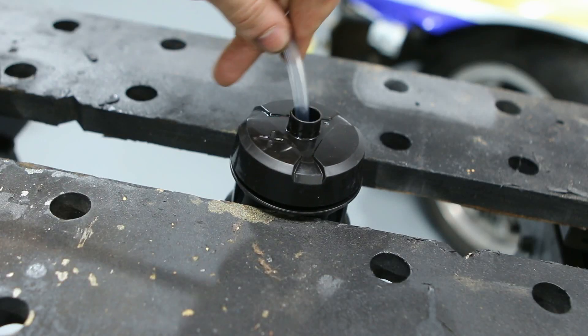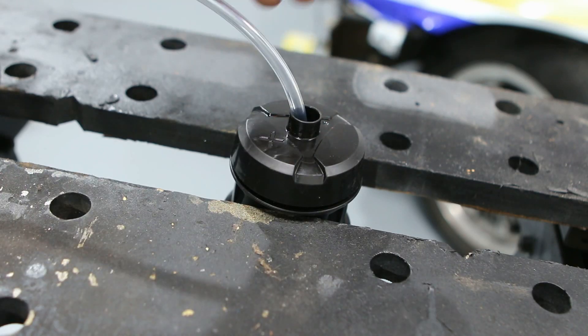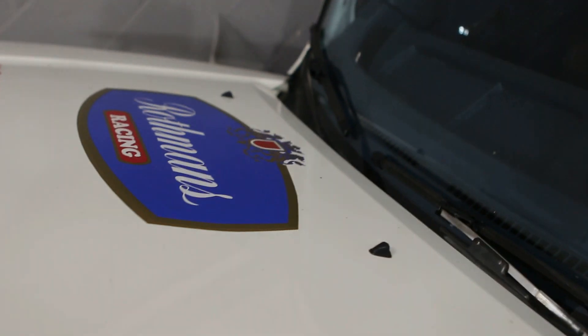Also make sure that next to the hole there's at least a little bit of air that can still go in, because if you don't let any air in while you're sucking all the fluid out, you will create a vacuum — and that's not preferable. Now here's how the plumbing works: one hose comes out of the bottle, goes all the way past here, comes out, connects to the motor. On the other side the hose comes out again, goes past the bottle, into the empty space behind the wheel well, comes out here, and then follows all the way through to connect to both nozzles. In theory this whole system should work.